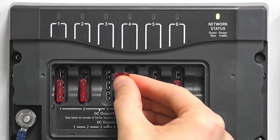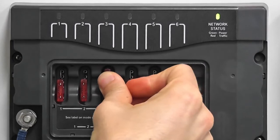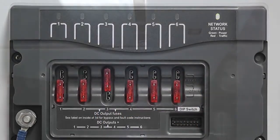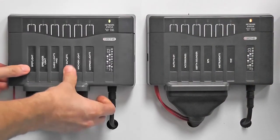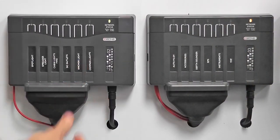In this position, the circuit has constant fused power supplied to it. If the circuit needs to be turned off, then the fuse needs to be removed. Replace the cover as shown, ensuring the rubber boot is inserted correctly, as the lid and boot prevents water and dust from entering the module. Remember to return the fuse back to its normal operating position once the system is up and functioning again.